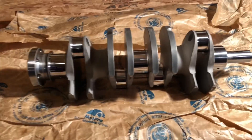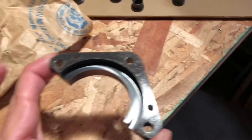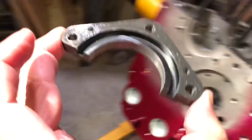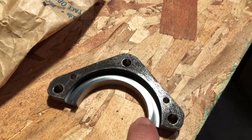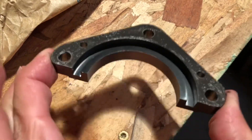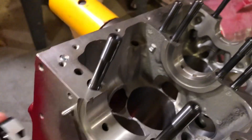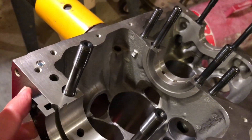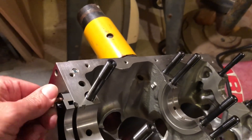We'll get ready to put our really nice crankshaft here. This is the rear main seal upper half onto the block - we showed the dowels. What I did here is I painted a very thin layer of RTV. Very thin layer - you do not want this stuff squishing into this channel in here. It's critical for channeling the oil back into the engine. So a very thin painted layer. Line it up to the dowels. We're not going to use a gasket - the gaskets tend to be very inconsistently made, with inconsistent thicknesses. We're going to trust that our surfaces here are all flat.